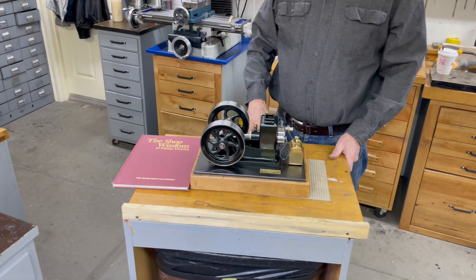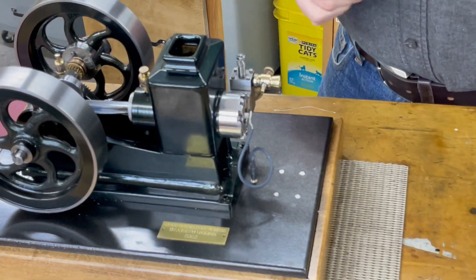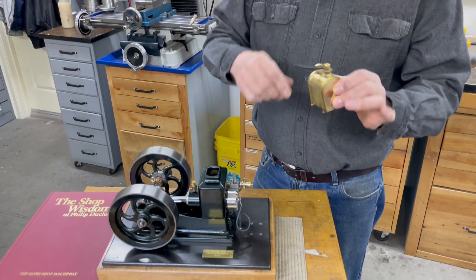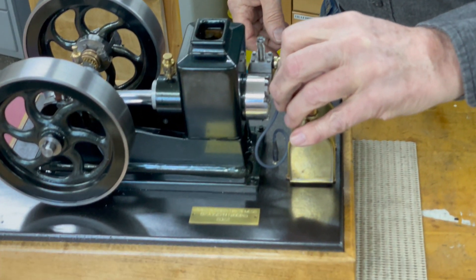I stuck with some of the changes I did before. First was the magnetic gas tank. It's very nice to be able to pull this gas tank off, take the cover off, shake the thing out, and blow it out after shows — it gets it really clean, which is quite important, because if crud gets in the bottom of that tank, it causes problems.